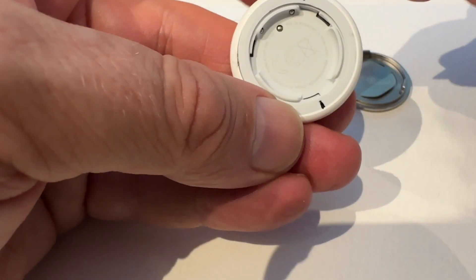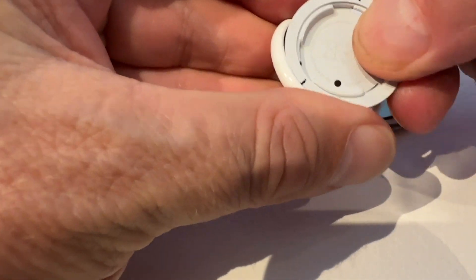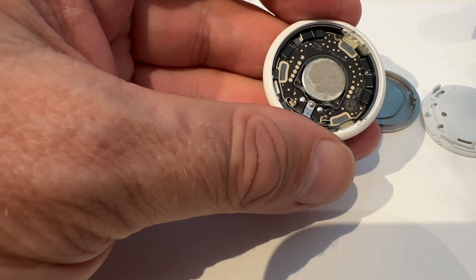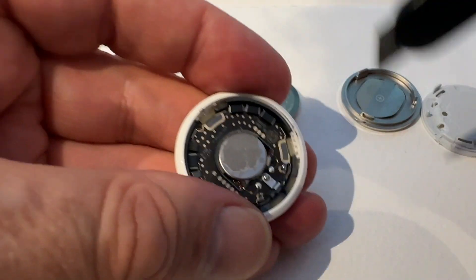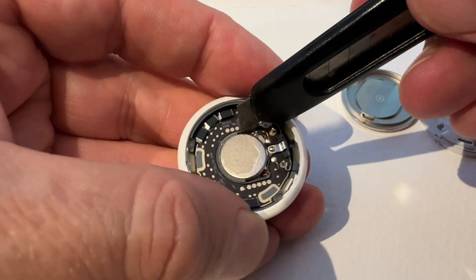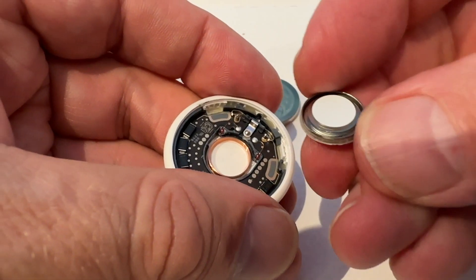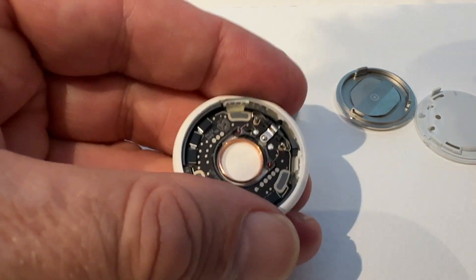Normally when you've got two of them popped, the whole cover will come off. So that's it without its cover, and in the middle here — that's where the speaker is. There's normally a little bit of glue or something like that which tends to seep around the edges, which sometimes you have to just break that seal. I'm going around very carefully, lightly breaking that seal, and often when it comes off it's magnetic so it'll just clip to your knife. And there's the speaker — there's not much to it really.